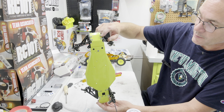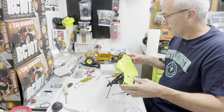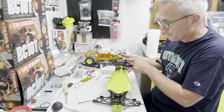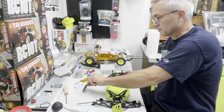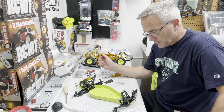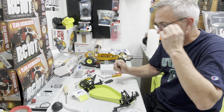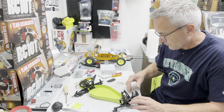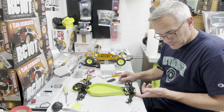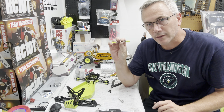There are our refinished screws on the back. On the front I had some stainless — I may go back and do the same deal because I don't like the way these stick up, and it probably wouldn't be a bad idea to clean out the countersink holes with a bit to clean out the paint. For the front end — we've got the body mount on, we've got to throw the front bumper on. The bumper's a little bit rough but I'm trying to keep in mind this is going to be a runner and it's going to get scratched, so no need to put a brand new bumper on. Next up is the linkages, turnbuckles — I'm not going to film a lot of that because we're just swapping out the old ball caps for the yellow ones.